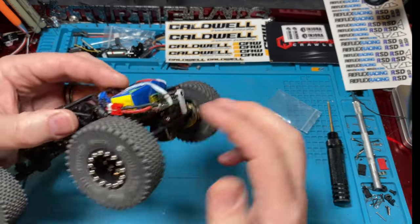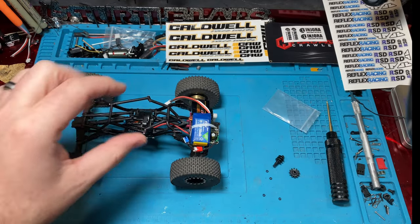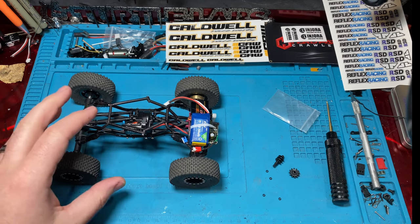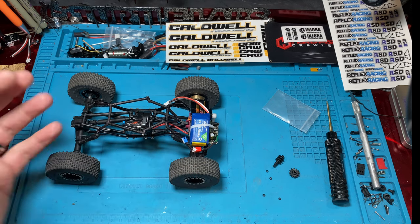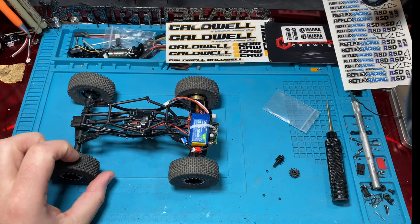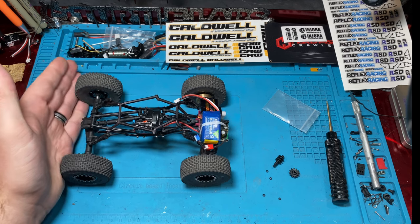We built this little servo tray. Anyway, it's not really about the rig, but the idea was that we're trying to keep the stock motor, trying to keep it as light and nimble as possible, and so we needed more torque. We've got decent wheel speed, it just seems like it needed a little bit more torque. So we figure we will reduce the speed in the rear, and that'll help push us along better.